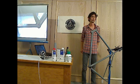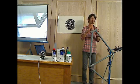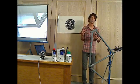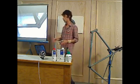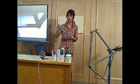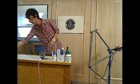So is the gun essential for doing fine work like this? Yeah, definitely. This is an ICON gun, so it has that fine atomization of the particles. You want that to not be too coarse. Some of the cheaper guns will just spit out coarser flakes of color. This one's really good at being fine, because this blue is extremely fine, and there's so much metallic in it that you can see every little imperfection. If you didn't have a nice gun, you would definitely see some ugly flakes in there. So that's important for that kind of thing, for sure.